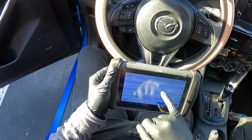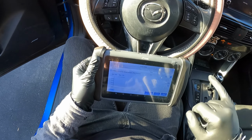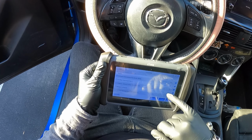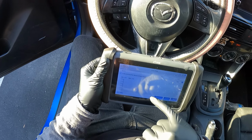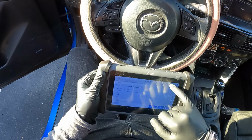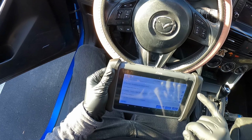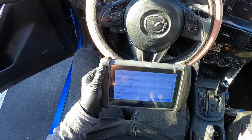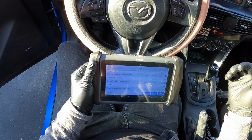In park, the desired RPM value is 650, and right now we are doing like 660. What is the max? If I click on that, let's see, the desired is 650, max 798, minimum 650. So yeah, we're within spec for the RPM, and it's feeling just fine. That's it, guys. So I guess it was just a MAF sensor that was the issue this whole time.